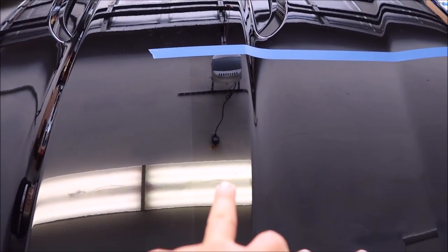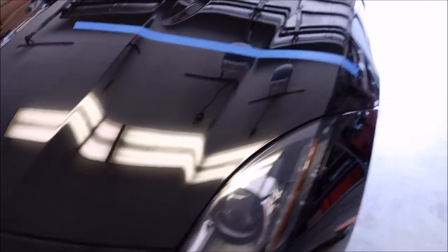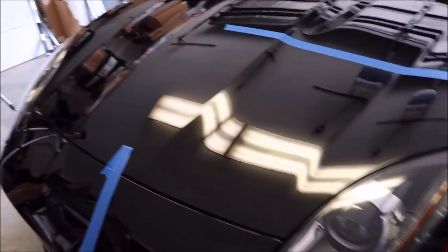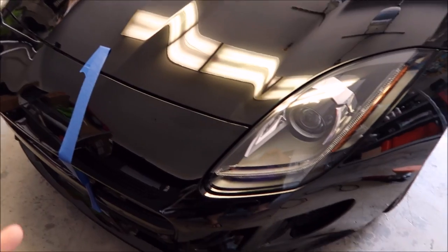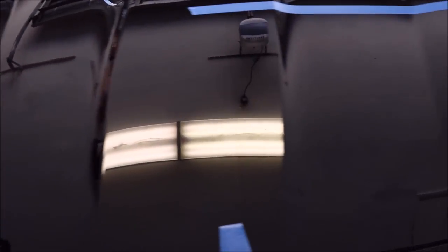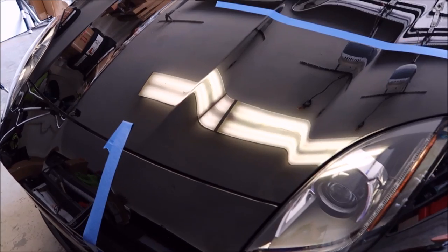Just like I just showed you, we can see a huge difference in the haziness here and the gloss here. If you look where the lights are, you can see a huge difference in clarity. The defect removal does a great, great job. These Jaguars typically have soft paint. I feel like if I would have given it more pressure, I definitely could have gotten more scratches out, but it still looks amazing. With soft paint, it's very hard to finish out a black car with no smudges and near-perfect clarity — which is what we have here. That's a testament to how well this polish finishes.